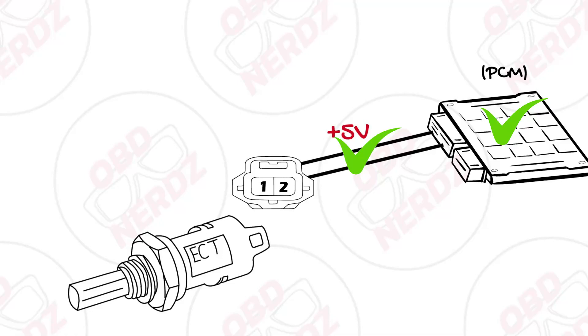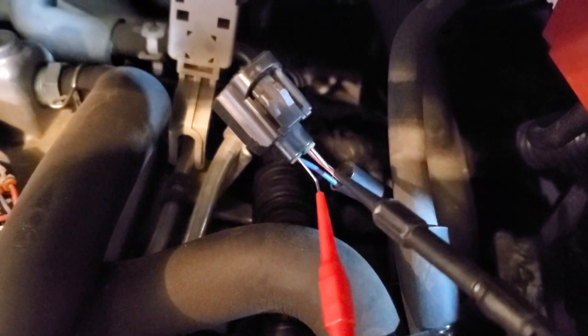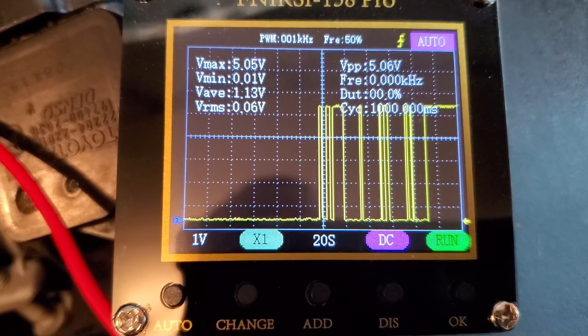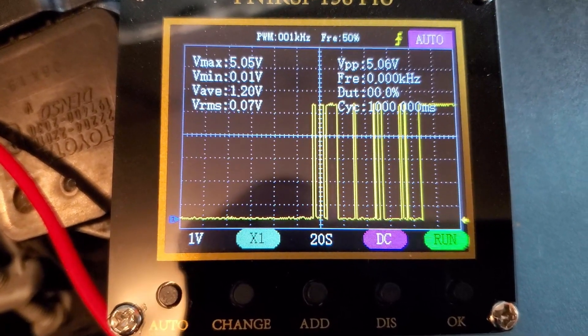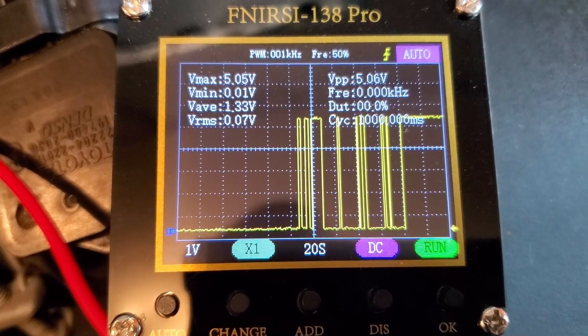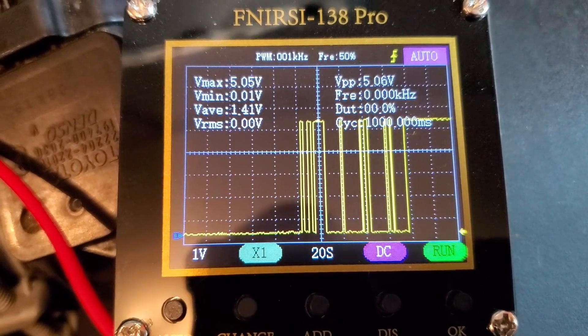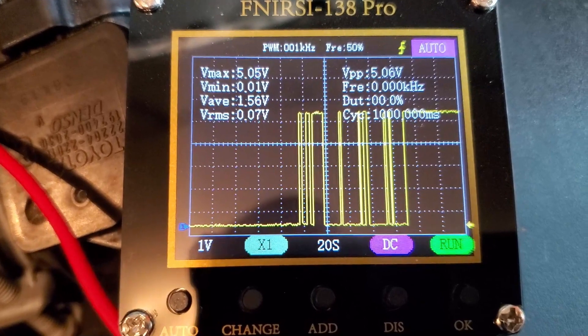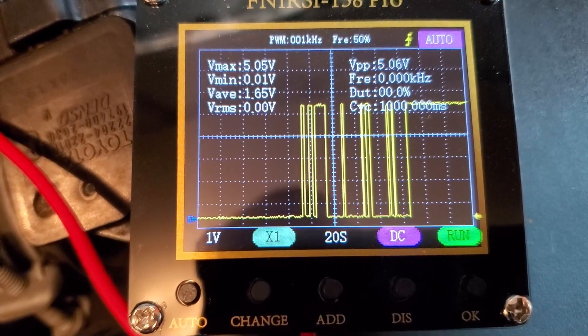There's only the chance that something could be just slightly out of threshold or not reading correctly at a certain temperature, but this is an overall test to show how I approach it. Next, I'll grab my oscilloscope. Here you can see that I've back-probed my connector. I always like to show off this little $35 oscilloscope — it's not expensive to get one. With the connector unplugged, I'm showing about 5 volts. I have it set up for 1 volt per division and 20 seconds going across, so you can see the voltage bouncing around between 0 and 5 volts as I was hooking it up.